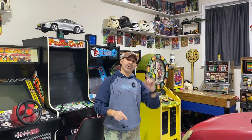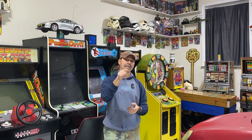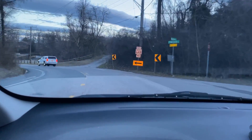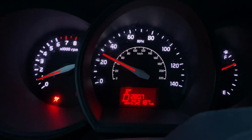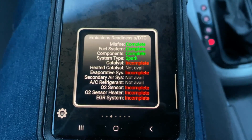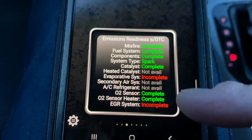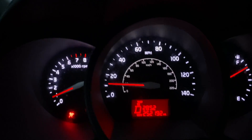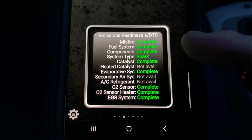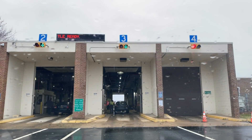Now that everything is on, we're going to take it down to the inspection center and see if it passes. After installing the extender, I cleared the engine code so we had a clean slate — no engine code on. I had my diagnostic reader tracking the vehicle as we drove to make sure it went through a proper engine cycle. You can see some components have completed and some are still incomplete as we drive. The catalyst did pass — complete and green — and by the time we arrive, everything has been completed and green, so we should pass this test.